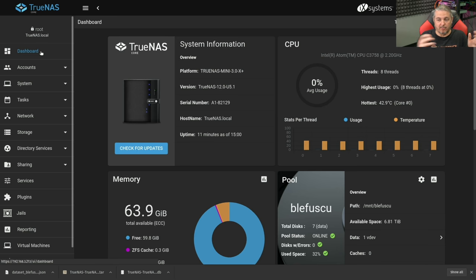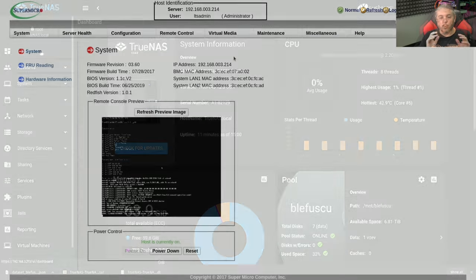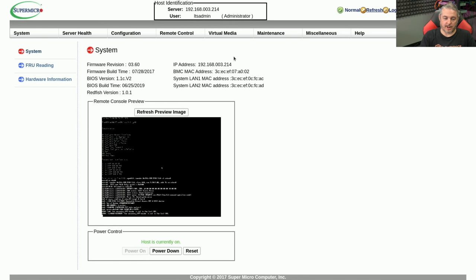Always good measure to have those before we erase this boot drive, because that's actually where the keys are stored — they're on the boot drive and they decrypt the pool. So if something happens to your boot drive, these things matter. Next step: we're logged into the IPMI of the TrueNAS system and we're going to use the remote control. Not every system has IPMI, but it is very convenient when they do. I like the IPKVM HTML5 version in here and we're going to go ahead and launch it.